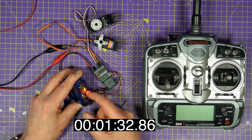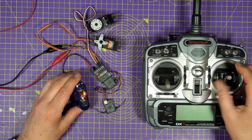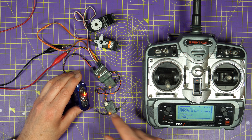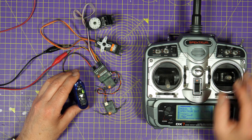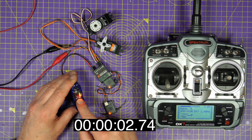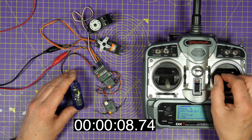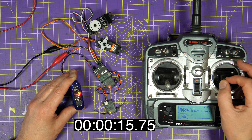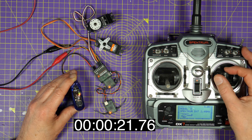Okay, we are fully charged. We've got power on the receiver — let's turn the transmitter on, that would help. We're bound. So we're flying around, not noticing our battery voltage. And then bang — I'll just turn the power supply off. Now the supercap has taken over. You can see it's flashing here, powering up the receiver, and I can still move the servos. So even though there's no main engine power, you can still glide or auto-rotate to the ground.